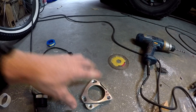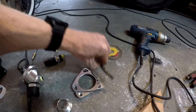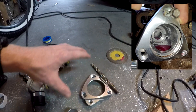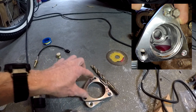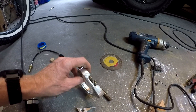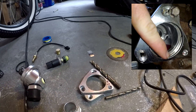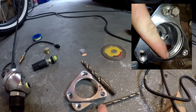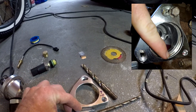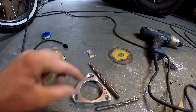The parts you have to cut off: I had to cut this section off because on the engine there's a part of the casting on the water neck that this thermostat housing bolts into — this needs to be cut off and ground into slightly. Similarly, down here there's a little bracket that hangs off; I cut this off — I actually mismeasured and didn't have to, but it does look better. That little bracket was in the way of this mounting flush to the engine.